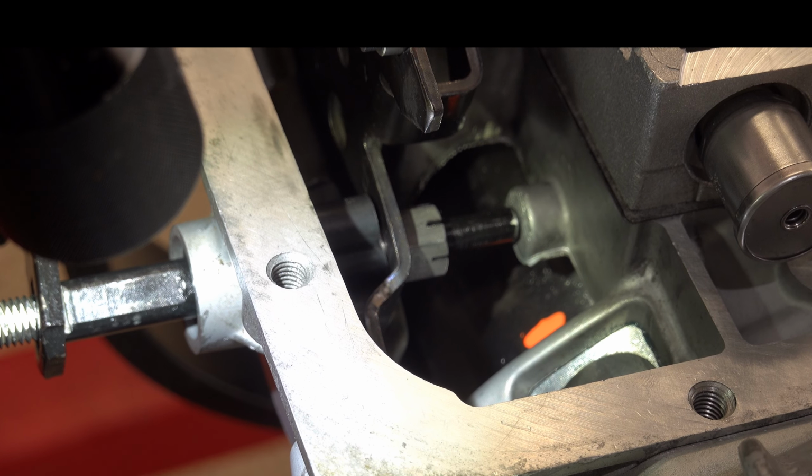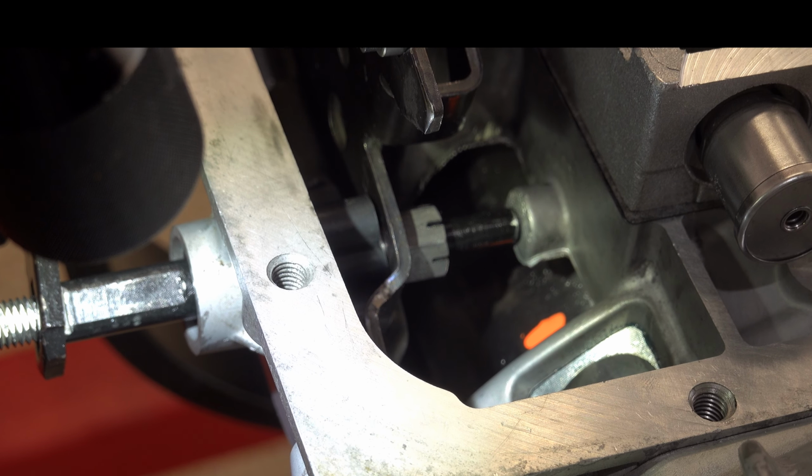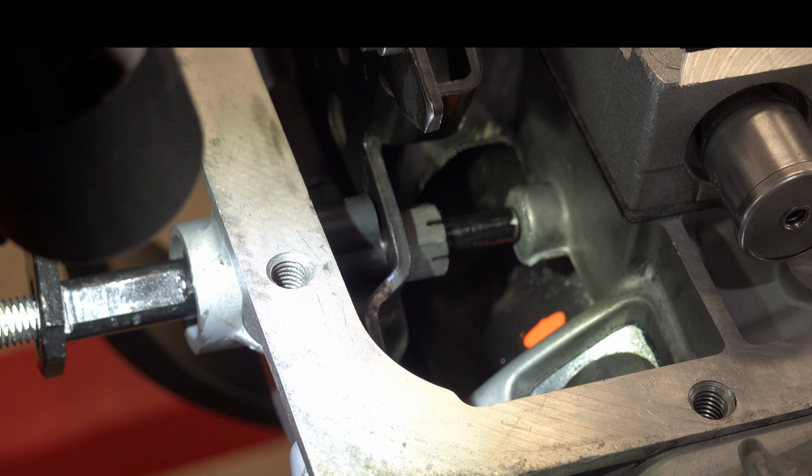So we're able to move this band right around 1/8 of an inch. That's the kind of movement that you'd want to see. If you had the privileged position of looking at this thing on the stand, looking down on it, and you can readily see what the clearance is all the way around the circumference of the reverse input drum that band has at rest position, then you would be able to truly confirm or deny that it's either good or maybe you should open it up a little.